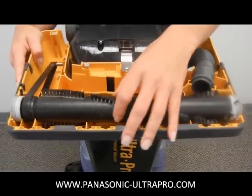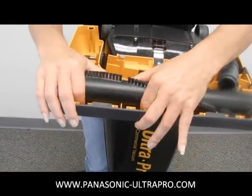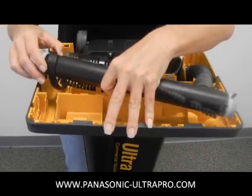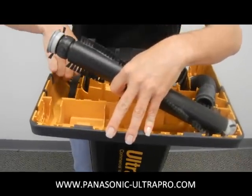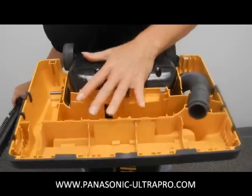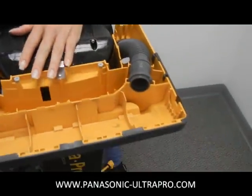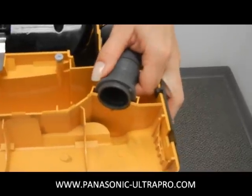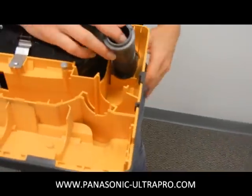So we are going to have her show you how easy it is to take the belt and the brush roll out. Always advise using the right side as a kind of a lever because the belt will be tight, especially when you put on a new one. So that's pretty easy to remove. Over here the hose fits in a little ridge that's simply popped out and you can slide it out the back.